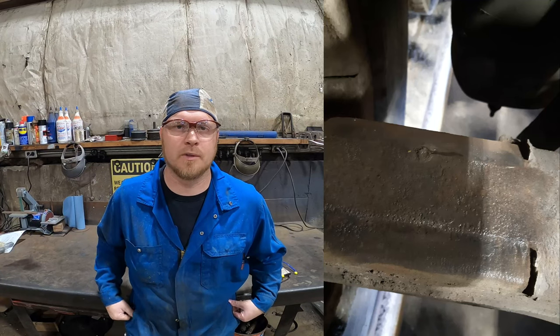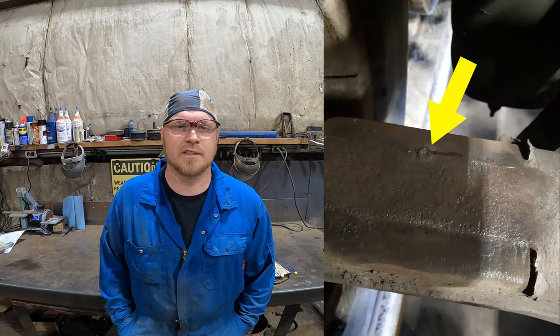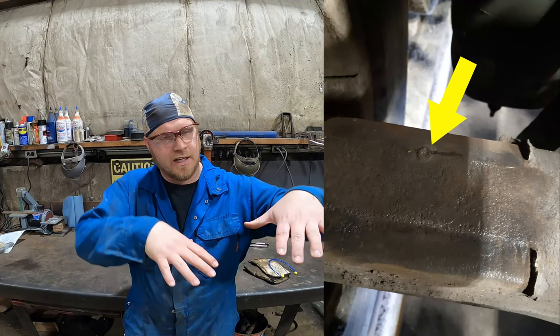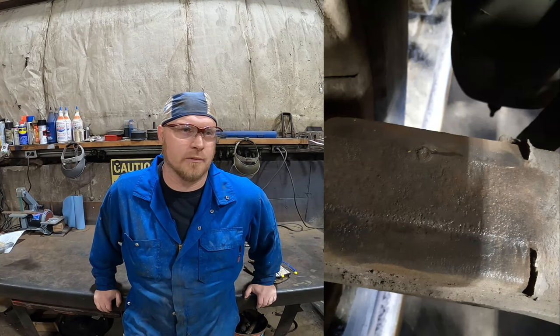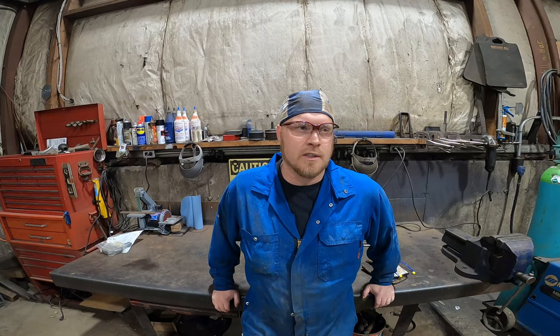Probably one of the most popular is the new Peterbilt Low Air Leaf. It's a twisted Z-bar suspension, and just because of the way the spring twists in the back and the way the airbag puts pressure on the spring, it always acts like a lever. It actually forces the U-bolts to come loose, and once it comes loose, the pin gets sheared off the axle.